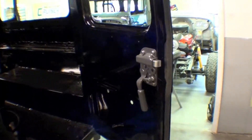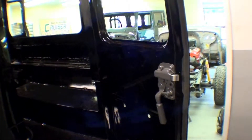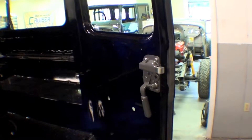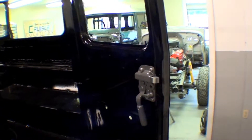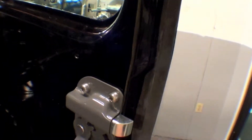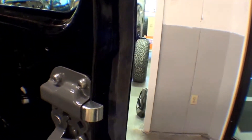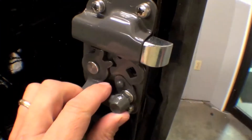We spent quite a bit of time this week doing a lot of small alignment type issues, and one of the things that we have aligned back here are the doors — rear ambulance doors. We're also gluing on gaskets. Those gaskets are the weather strips that go around when you're doing a fitment of a door. It's important that these be on to get the final fitment.